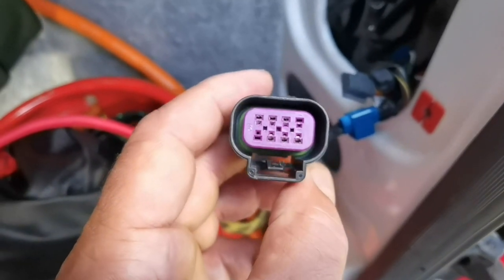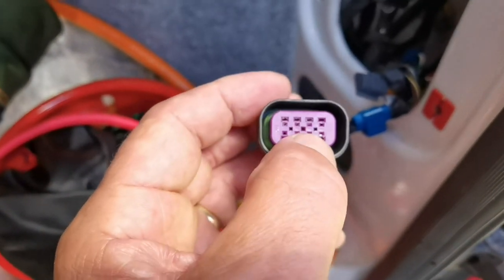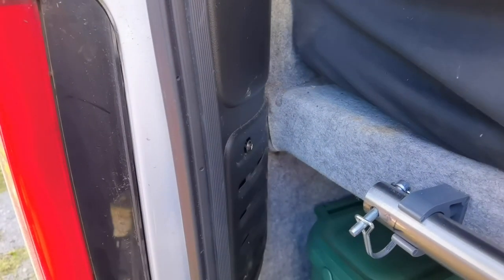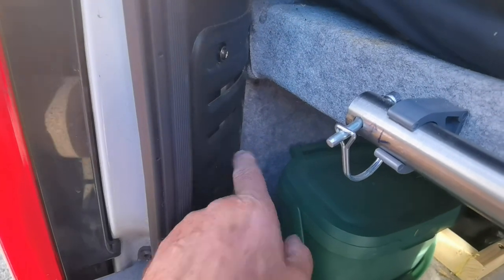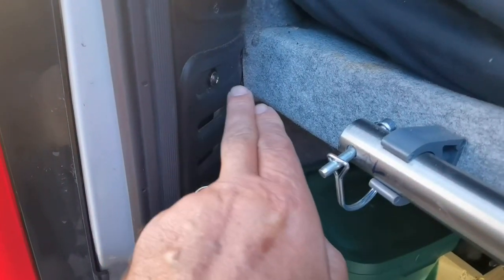I'm not going to tell you the color code because it differs between vehicles. This is a 2016 Fiat Ducato. We found out that the right side is fine for stop and tail light, but not for the left hand indicator. So looking at the back of the vehicle, when we took the module out that plugs into the cluster, it was the blue and white one.